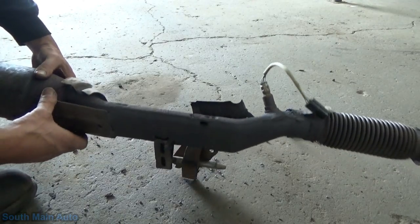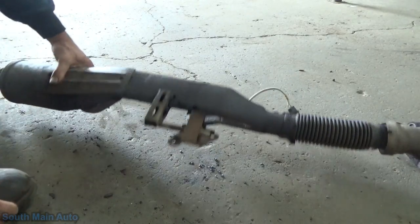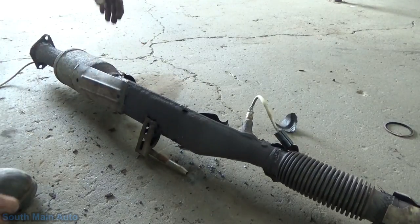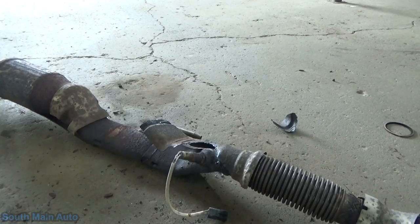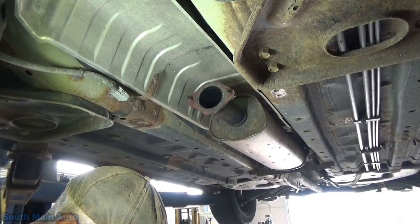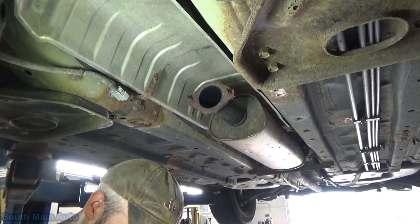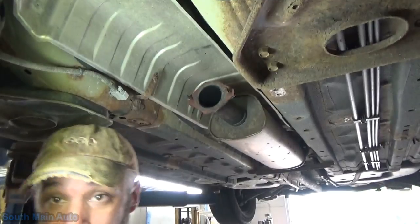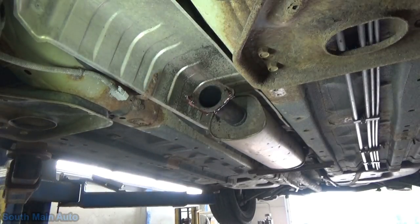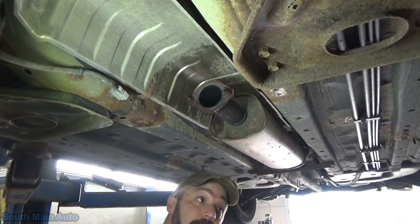There we go - now you can see the old rust hole. I had more than just these ones here. We'll take that off - you can see she's pretty dang thin. She's funky and punky. Let me go get a 22 wrench to see if we can get that O2 sensor out. Before we do that, since I know I don't have nuts to put back on these studs, we probably ought to run a thread chaser over them - looks like a 10 by 1.25 maybe.